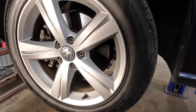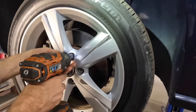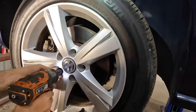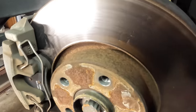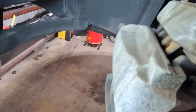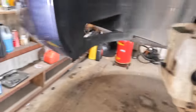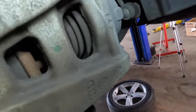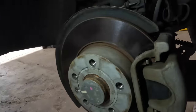We've got the nut covers removed. Let's pull the lug nuts out. All right, looking at the front pads — about nine to ten millimeters. Those are really good pads. We're not going to put new pads on it; I'm making an effort to reduce cost as much as possible. That's a lot of friction material — these are good pads. Inboards are looking good too. Let's check the rears.